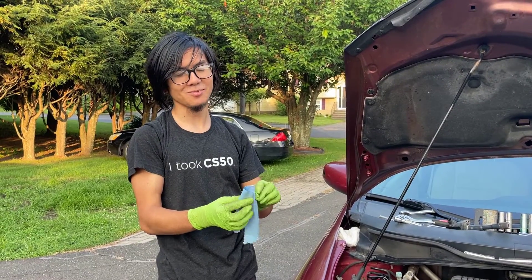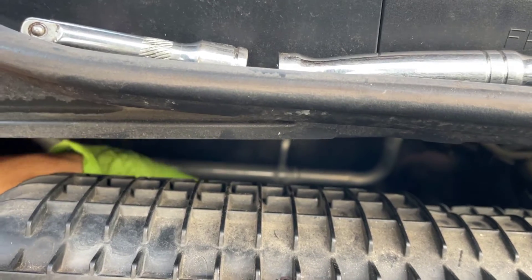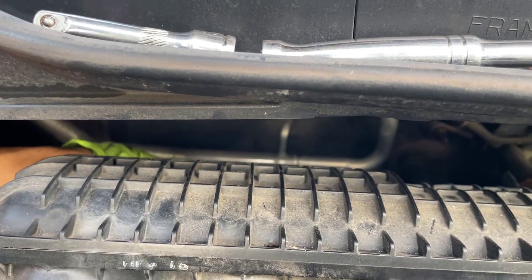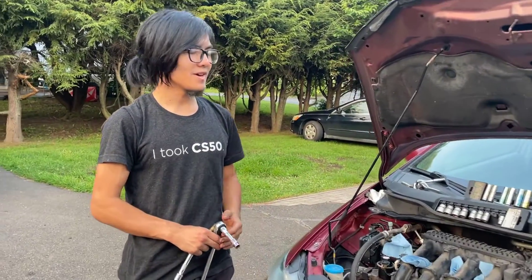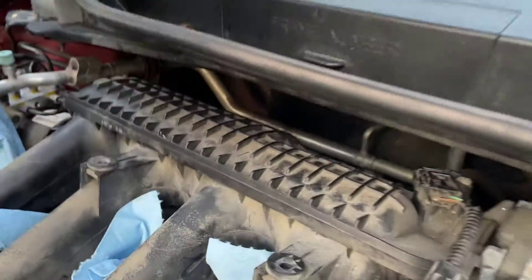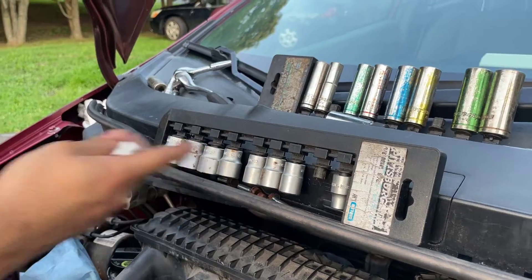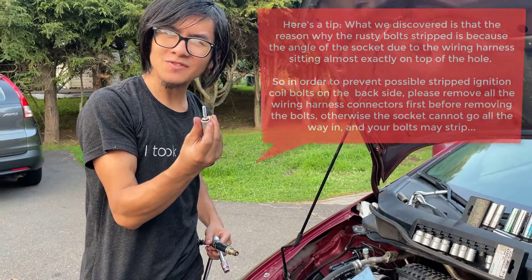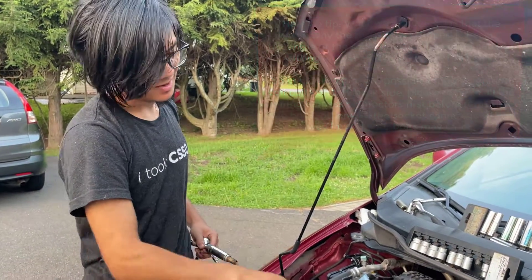We're going to do the other three but won't show on camera. The most important thing is to stuff the hole — make sure no contaminants get in, especially because we can't exactly see what we're working with, and there's a chance that bolts could fall into the hole. We got all the spark plugs out. At one point we encountered a stripped bolt and had to use a bolt puller set. Since replacements may not be available at AutoZone, instead of putting the stripped bolt in the back where it's hard to get out next time, we'll put it on the front side instead.